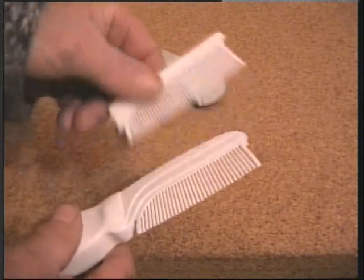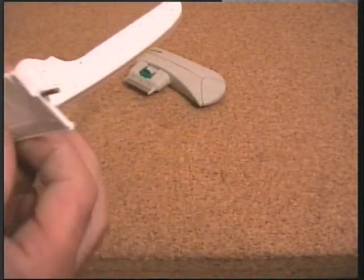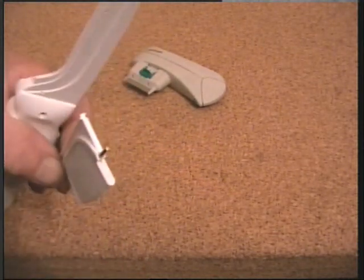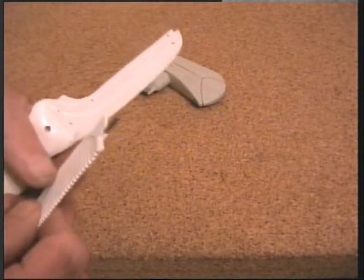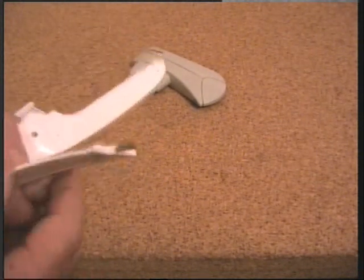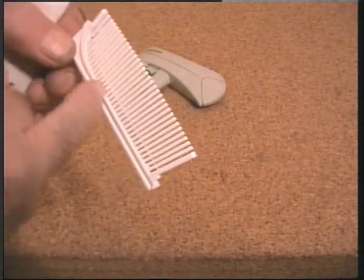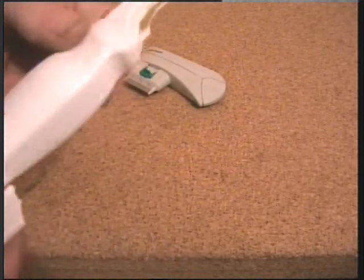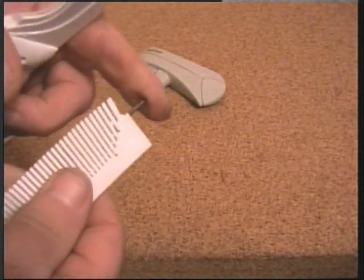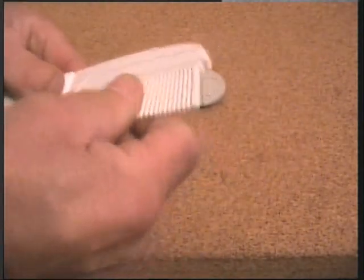There's an even coarser comb. They slide out, and it's only got one connection. How can you zap something with only one connection? This is why birds sit on 1000-volt overhead power lines and don't get zapped — they can't straddle their feet to the other line. Looking very closely though, there's obviously a connection right up in the base, and looking carefully at the comb, there's a brass connection to one side. So this is obviously one pole, and when the comb is inserted, that's the other one.